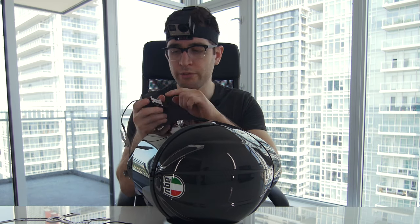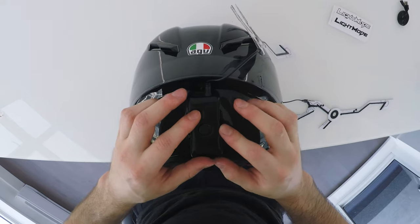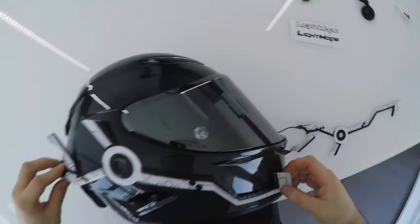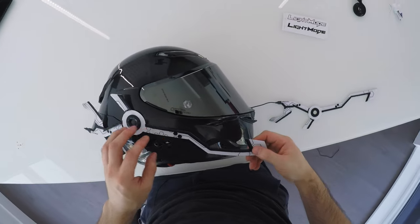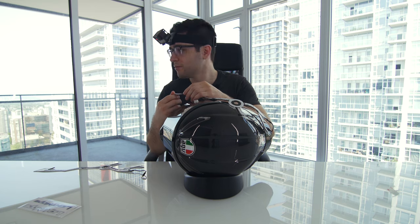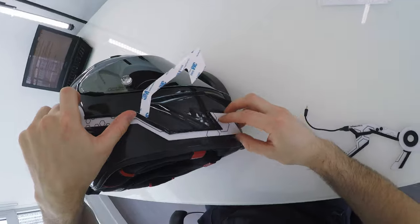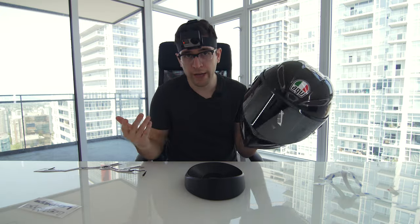Once you're happy with the positioning, peel off the 3M backing from the mount. Don't press too firmly at first, just light in case you want to reposition the controller later. The adhesives on the Night Shift LED strips are stronger than the previous gen, so pay attention. It's not going to damage your helmet — just don't stick and unstick too many times or some adhesive might remain. Pro tip: peel off a section of the backing, anchor the LED strip, then gradually peel the rest and stick the strip from one side to the other. Then do the other side.